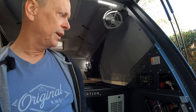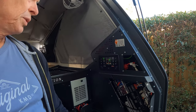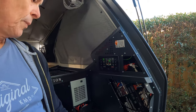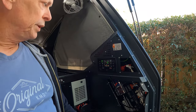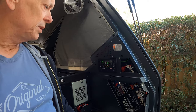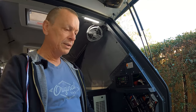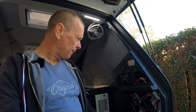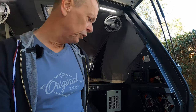Welcome to the next day. We finished the lithium installation last night, and as you can see I've had it on charge — we're now at 100%. Because we had the battery disconnected, we had to reset the Redarc TVMS system and it had to re-establish battery capacity, which tends to happen when you leave these disconnected for a little while. So now fully charged, we're going to run a little test this morning just to see how the inverter works.